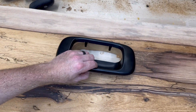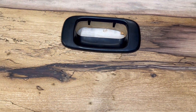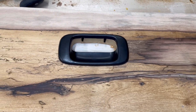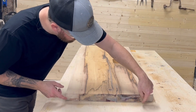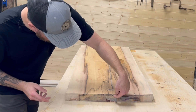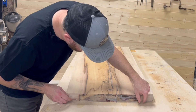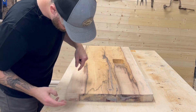I bought a rebuild kit that's got all the parts for it, and that cover is perfect — it's gonna cover up all my little imperfections around the border. Now I'm going to cut out a groove on each side on the back of the tailgate, about an inch deep, leaving about a quarter inch of material. All of the mounting and mechanisms that move the tailgate and latch are mounted back there, so I've got to be very careful doing this.